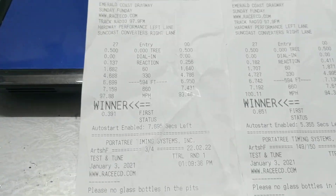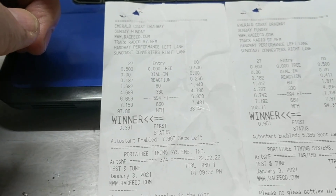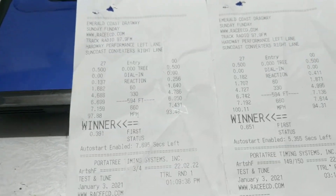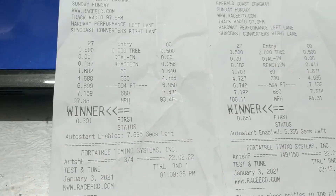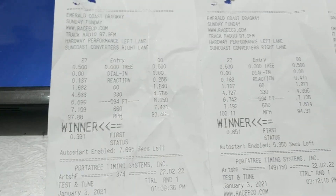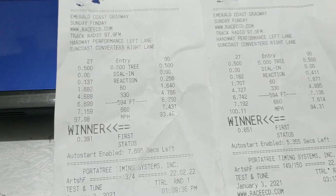So the traction lock gave up on Stuper Trooper again. What happened was the little emergency brake pawl kind of hung a little bit on the driver's side and it wasn't releasing — that's what was causing the issue. I thought I was doing the right thing by putting new cables and calipers on there when I converted to disc brakes, but still had issues with it.